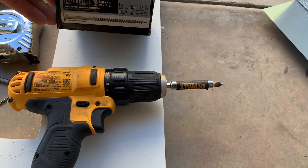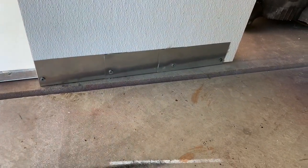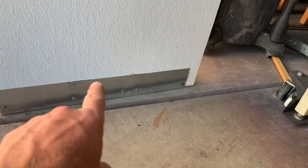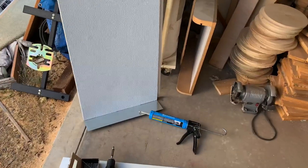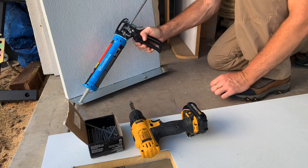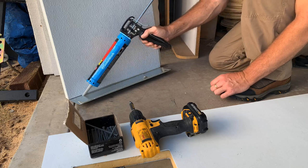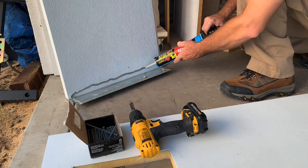I'm using four-inch exterior coated screws along with the adhesive. You can see I've got four of them installed, and then where the screw heads are, that trim piece goes across the bottom, and everything will be sealed up along that edge with EternaBond. I'm using Loctite PL fast-grab — it's got a really good initial grab. I'm just going around the outside and then a little bit in the middle, and one little bead right there to grab the floor.